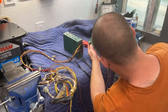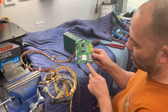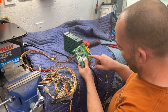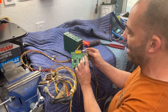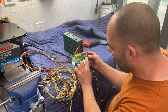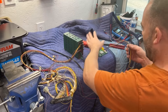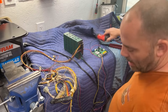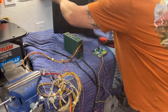This connector on the converter board will work with the normal Jamma harness connector — it'll plug right in. They give you a couple of different options for plugs. I can see on this converter board that the red, green, and blue pots have all been adjusted before, so we might have to tweak those if the colors are off. Now that we have power going to it and the video connection going to it, let's grab one of these monitors and connect a VGA cord and a power cord.